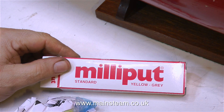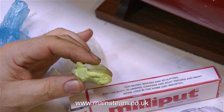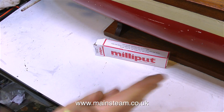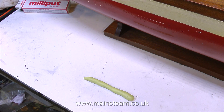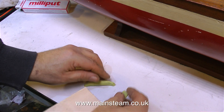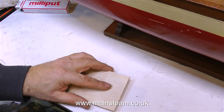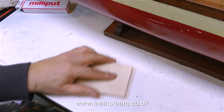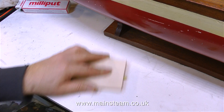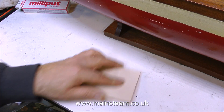And now for the belt-and-braces approach — this is Milliput, an epoxy putty, and I had some left over from a previous job. Rather than let it go hard and become unusable, I put it to work here. I mix it between my hands for several minutes, split the resultant mixture into two, then use a piece of wood to form two neat lines, which I press firmly into place down each side of the shelf in the bow. A very useful feature of Milliput is that it's water soluble — once applied, you can smooth it out just using some water on your finger.